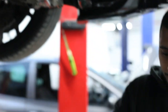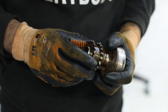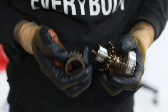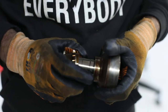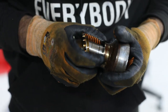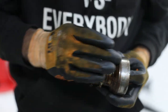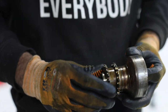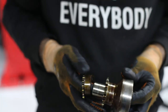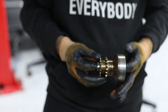So this is how it's come out — this is the standard crank hub. As you can see, both of them spin. They're only held with friction washers. There's one on each side. The billet one that we put in is a one-piece unit with four pins, and I'll show you that shortly. This one isn't very good for big power, because under a lot of torque it will spin and jump the timing chain. So that is no good for stage two and above.